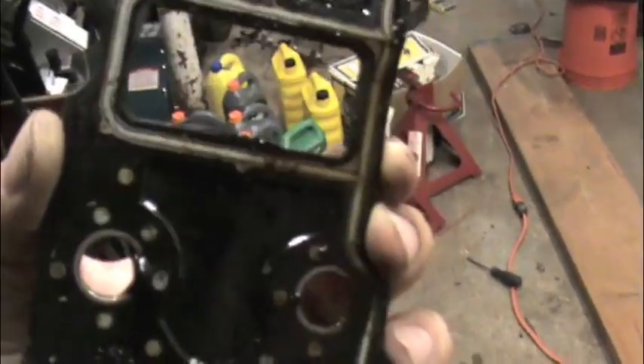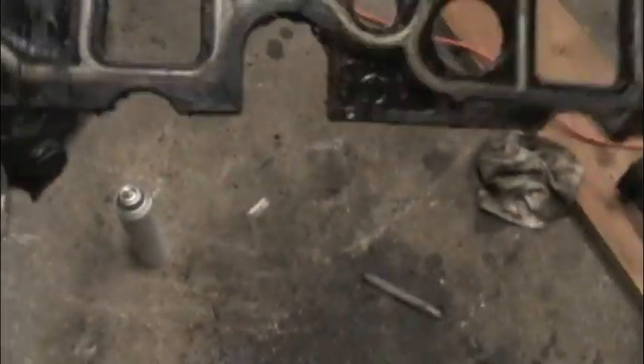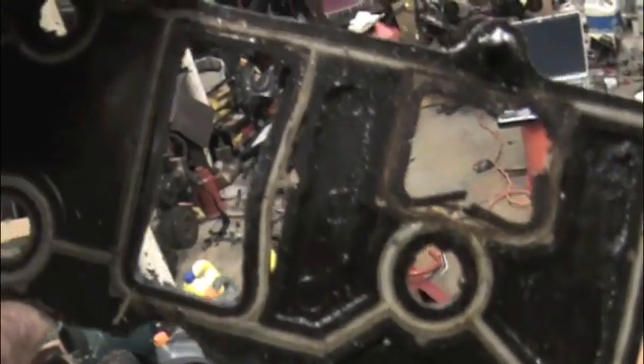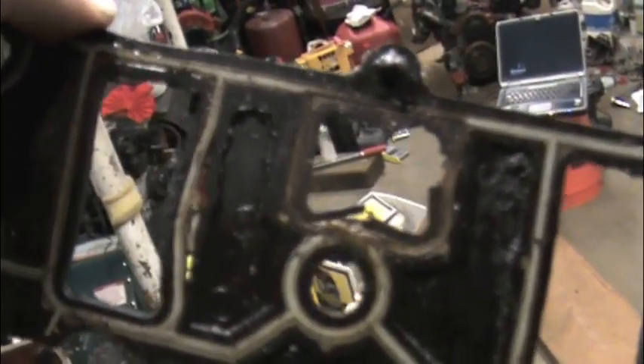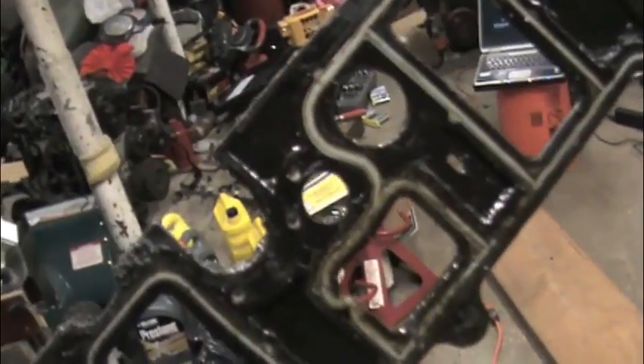And that's what happens with this — this whole thing is made out of plastic, and it just has the rubber gasket material on it. From the heat, and supposedly from Dex-Cool, it breaks it down. This one's really bad. That's the intake right there, and that's the coolant one. Both of these are real bad. Really, just this gasket is garbage.